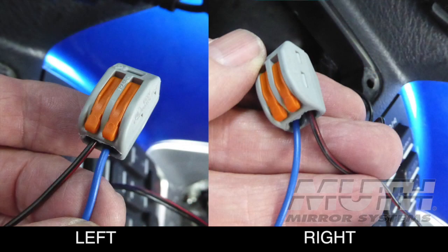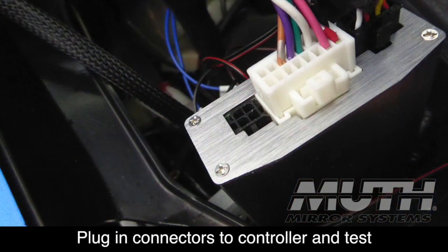Now the positive wires that come from the mirrors have the red stripe on them, and I'm connecting those to those blue wires that come out of the controller. I'm also using these clamp style connectors, and I will put in the description below a link to where you can purchase these clamp style connectors, but you could also solder these wires or use any kind of splicing connector you want. Now would be a good time to connect these two harnesses to the back of the controller and test the system. Just walk behind the bike to see if the lights on the blind spot monitor show up in the mirrors.